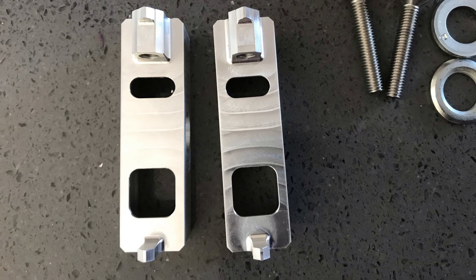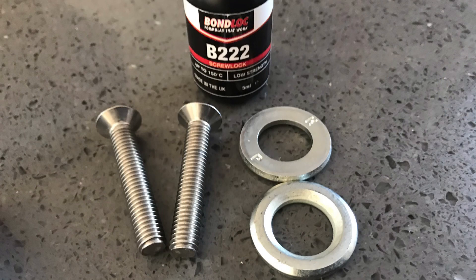You'll find at the back end of the swinging arm, each of the arms underneath has a round hole. Don't be misled into thinking anything's got to locate into that - it doesn't. Those holes, I believe, are just drainage. I renovated a Yamaha XV250 that had the same sort of box section type swinging arm. It didn't have drain holes and basically it rotted from the inside out. The Stratus Performance doesn't use those holes at all.